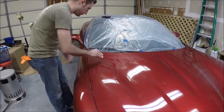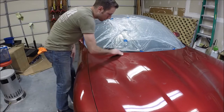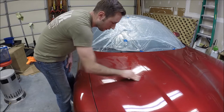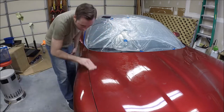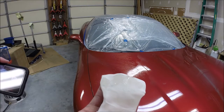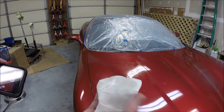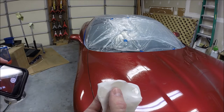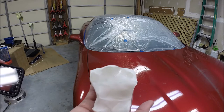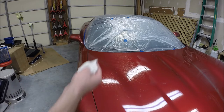Just wet down the surface you're going to work on. Really, you're just rubbing the bar of clay across the paint. See that? My paint is not too bad — I've done this before on this car. But you can see as the clay starts to darken, that's where it's picking up contaminants embedded in the paint. Then we'll just wipe this down with a microfiber towel and keep moving.